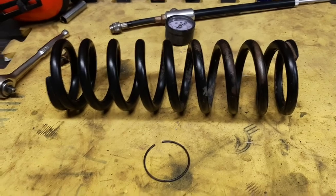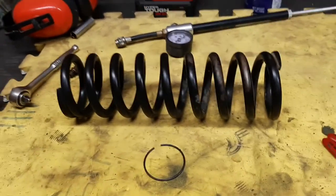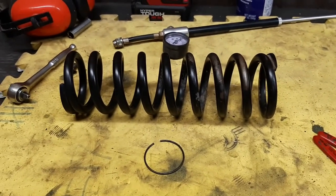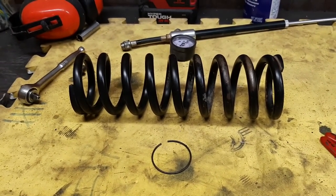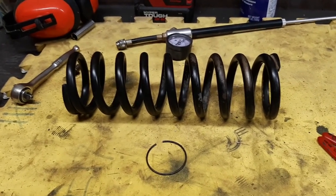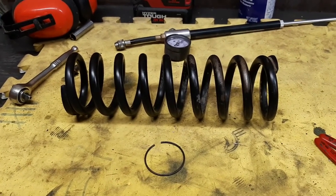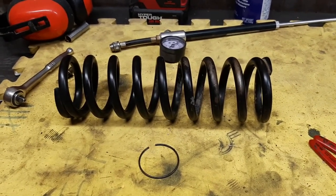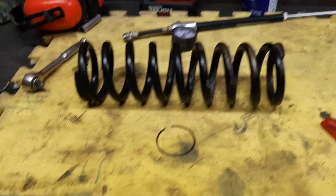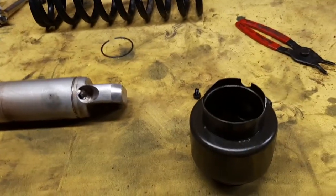Everybody says change them. I actually thought it worked fine. I actually thought somebody had probably already changed it. Because when I was riding down gravel roads and hit washboards and stuff, it was kind of bouncing me around, so I actually took it to the lowest setting of preload and turned the rebound damping up a notch and liked it much better. Now, I did jump the bike one time and it kind of bottomed out, but this bike was really not meant to fly.